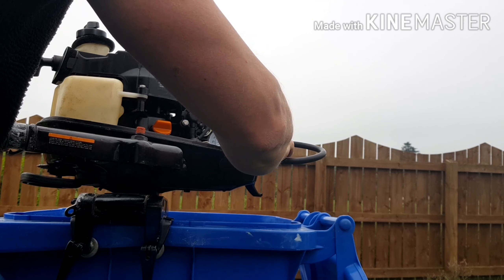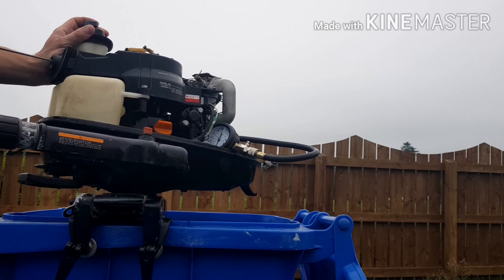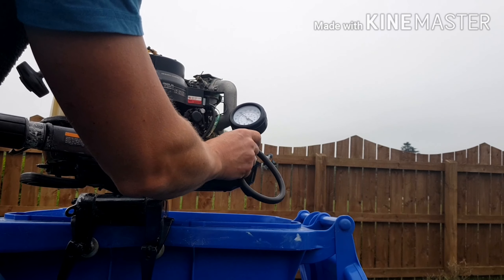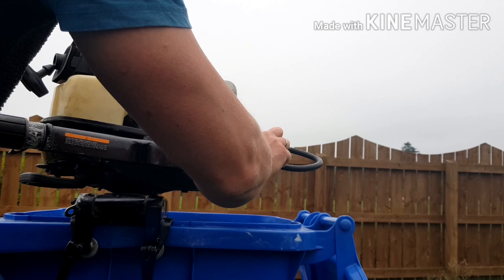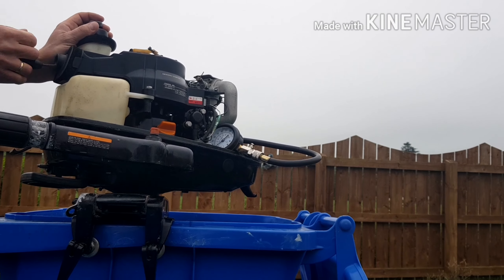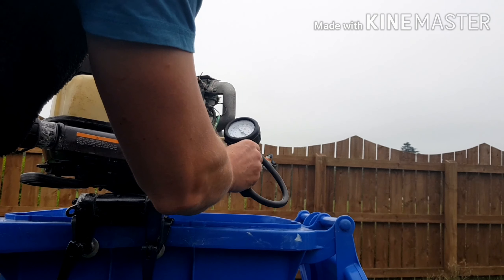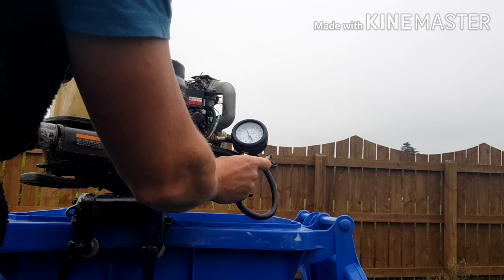That's better, but we're going to try again — it's quite erratic. Open throttle, 9 pulls, we're getting just under 100 psi, about 95. We'll try once more: 9 pulls, and now we're getting 110 psi. I'm going to go ahead and take this reading: 110 psi.